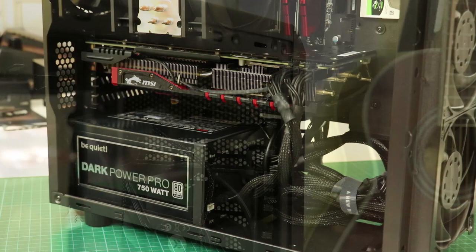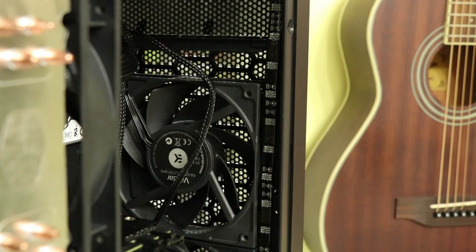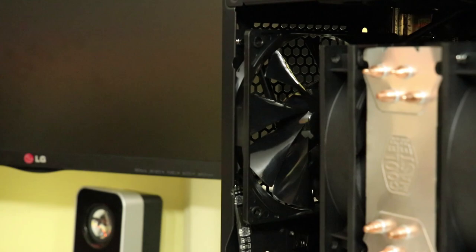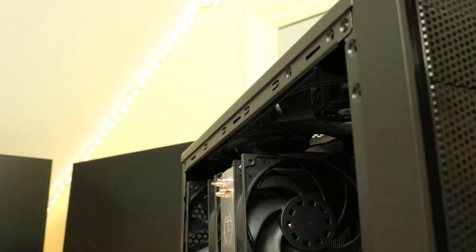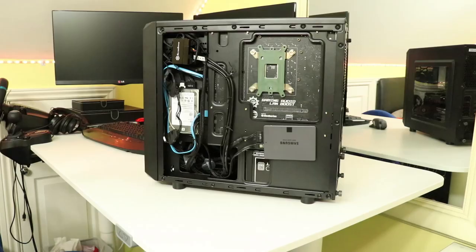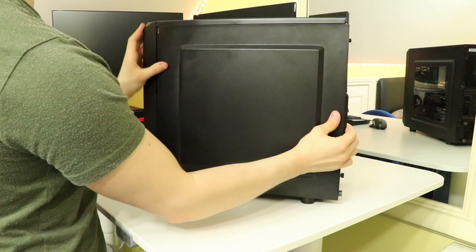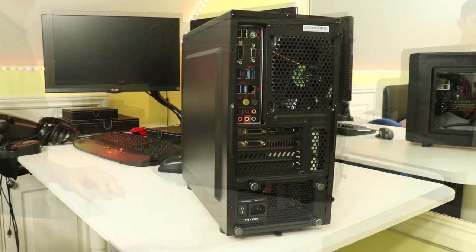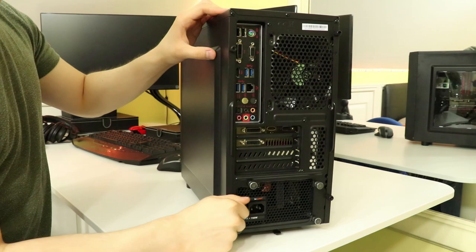Now we can move on to some finishing touches. The LED lighting strip was not an issue for the majority of the case — the front strip sat perfectly down beside the front fans and continued to run across the bottom without any issues. However, with the rear fan installed the lighting strip cannot make it through to the top of the case, and with two top-mounted fans you won't be able to mount any LED strips up there either. Replacing the front panel was relatively pain free, but the tolerance to the Hyper 212 Evo is extremely tight so I couldn't suggest any cooler that is larger. Replacing the other side panel was much harder — the tolerance was so tight that I had to remove the wire tie holding the fan hub as it was preventing the clips at the front of the panel from latching into position. The pop-out on the panel doesn't help much with cable management, which generally takes place around the edges of this case.